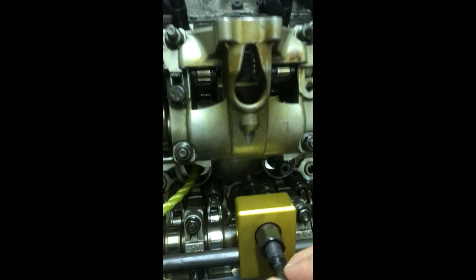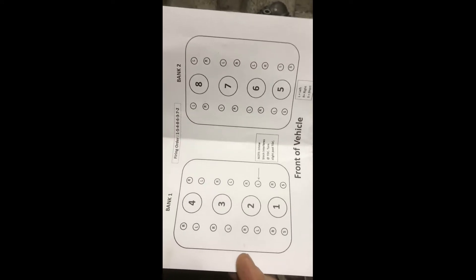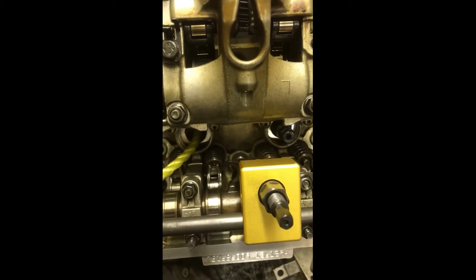Now I can use my tool - you can see I have it hooked up here, it goes right onto the engine parts with those little brackets. We have our movable part here. The kit comes with a shorter compressor and a longer compressor for the valves on the bottom or the valves up on top - intake and exhaust. It comes with those little crow's feet; there are three different ones labeled L, R, and S. Along with the kit, like everybody else has shown, you get this little piece of paper. I've seen videos where people say the paper isn't always the right recommended one, but everything worked just fine for me.